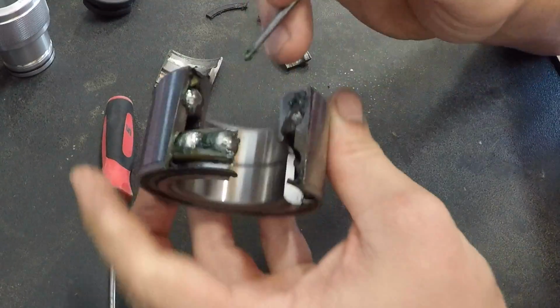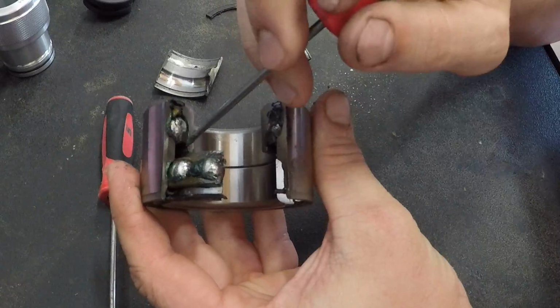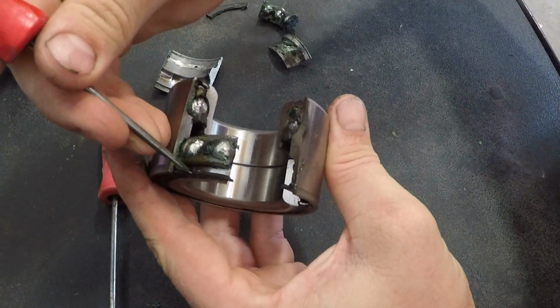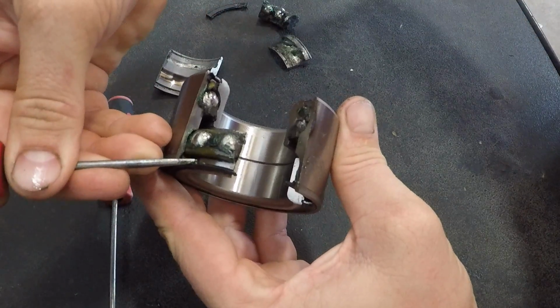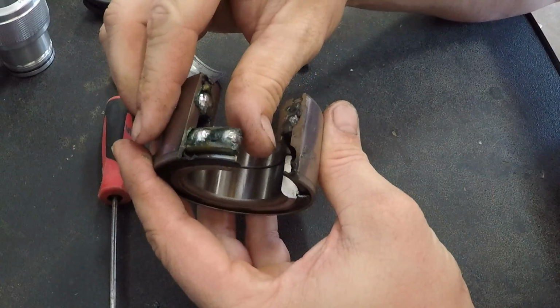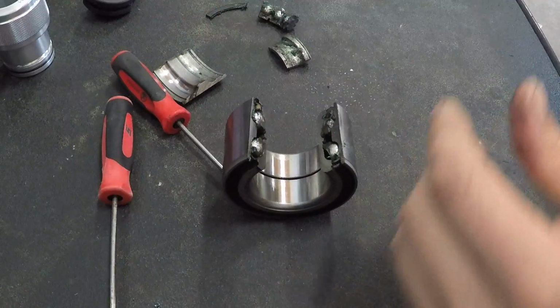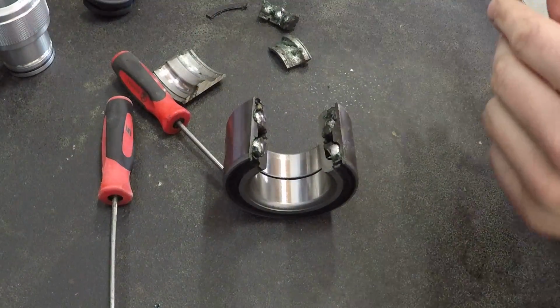So when the grease enters the middle cavity here, through the split in the inner race, it fills the cavity, and whenever it's full, it'll just fold the seal out just slightly, just enough to release the grease. And as soon as you see that, that's whenever you stop. You stop, remove the tool, clean up the excess, and you're ready to reassemble. So there's that.